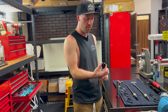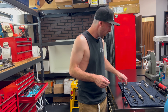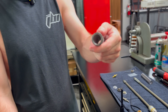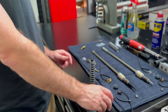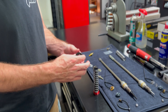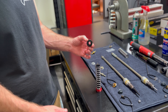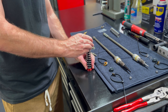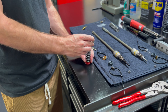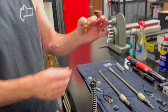The pressure springs don't come in the DIY kit, but we can sell them additionally if you need one. This would be the time you'd want to change out that pressure spring — you can do that by just sliding off the free piston. We're going to have a plastic spacer and then our pressure spring comes off. Grab our new 16 — these aren't directional so you can put it on either way; I like to put the numbers going up. Our plastic spacer is going to fit back in place and back with our free piston. There's an O-ring on the inside that seals against our free piston shaft, so take your time reassembling and don't catch that O-ring in a way that damages it.